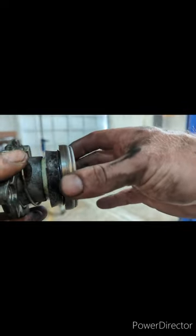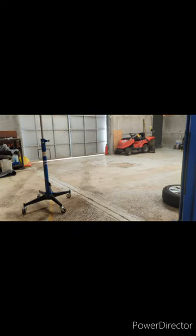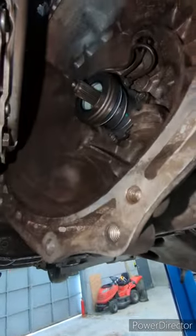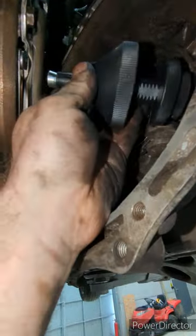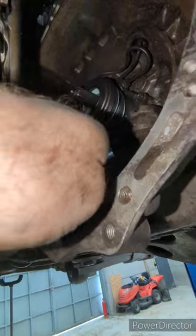Now that's actually off — not only does it feel completely gaunchy, but there's no grease in it at all. It's completely metal on metal. One thing to do: put the clutch in first with the alignment tool before putting the slave cylinder on, because otherwise they fail and you can't do it.